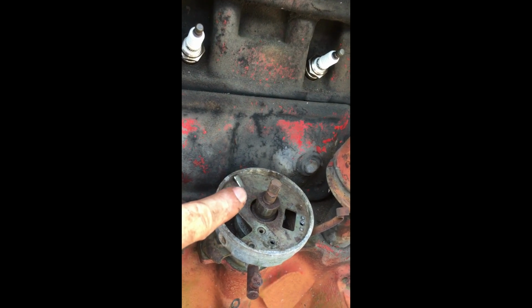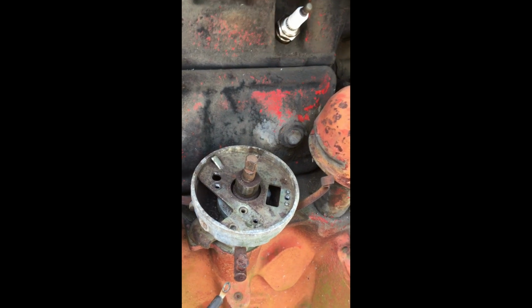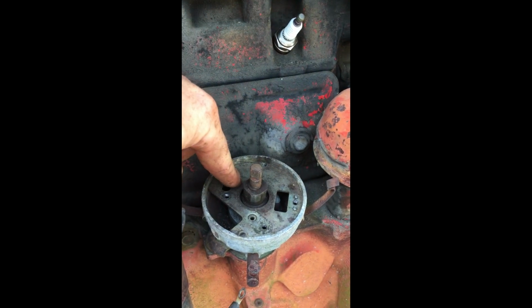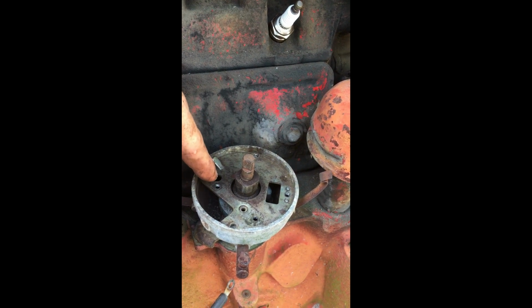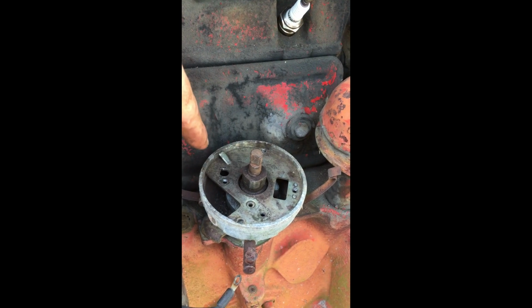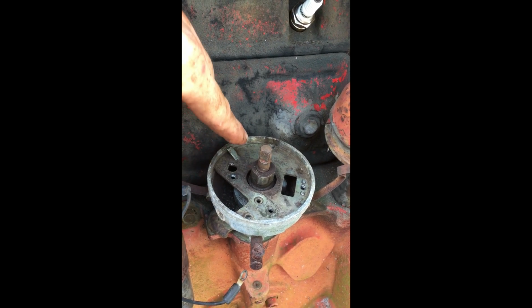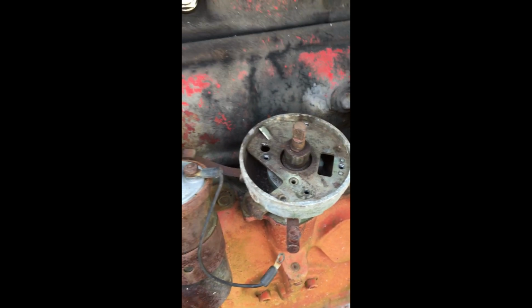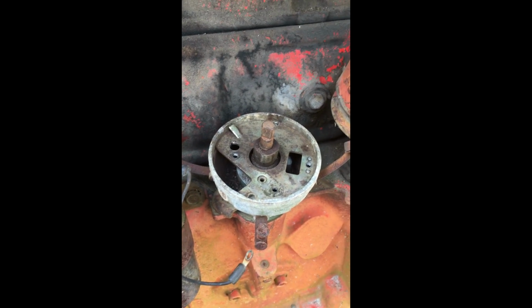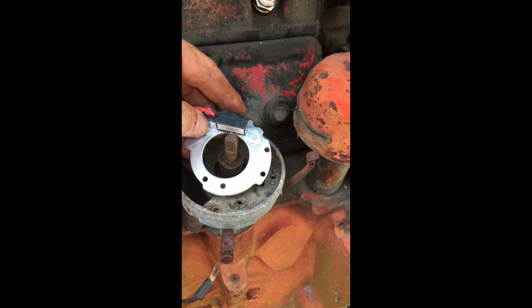Secondly, we have the cap off of the distributor. The distributor cap, the rotor button, and the dust cap cover. This is the plate that the points bolt to, and you take your points and condenser out, and I'm sorry I didn't document that. There's some other great YouTube videos about taking that part out, but I'll have my camera going from here on out. The next thing we're going to do is put in that plate, and then we will be putting in the igniter, electronic ignition. So give me just a sec and we'll catch y'all up on that.